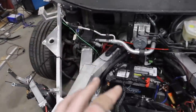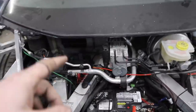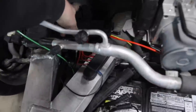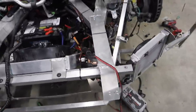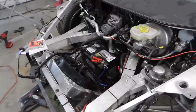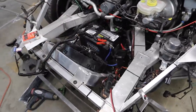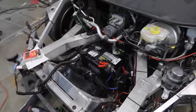We also did some cool stuff with the Haltech ECU as far as programming, temperature-wise. We have triggers so that when it hits a certain temperature it triggers the water pumps — turns on all the water pumps in the car, which is what two of these relays are. Then when it hits another temperature it triggers and turns on all the fans. We just got done testing that out — these Mishimoto fans are ripping. Everything is fused properly, everything is relayed properly. It's a really good home-cooked method of getting this stuff together in the proper way, so it's all safe. I'm really happy about it.